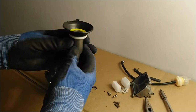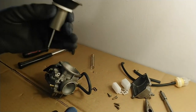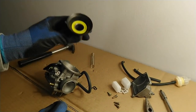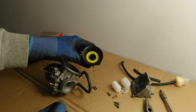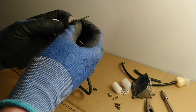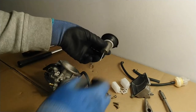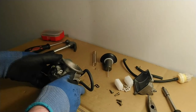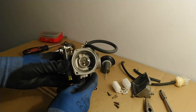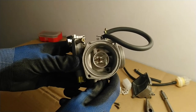If you take out your diaphragm, you must check it for any damage — even any tiny little holes will ruin the vacuum, so be careful not to damage it. It is very important for the proper working of your carburetor. The next thing to check is your needle, which can wear over time or get damaged and may need to be replaced. Looking down into the vacuum chamber, you can see right down to the jet where the needle fits in at the very bottom.